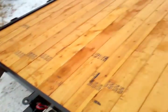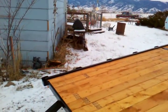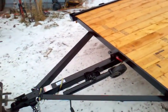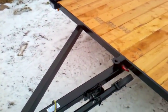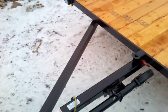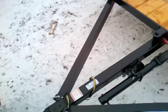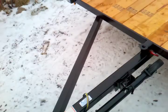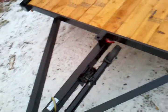Unlike a normal straight tongue snowmobile trailer, this is a tri-frame tongue with three hinge points underneath, and they're all grade 8 bolts. That tri-frame tongue keeps you from shearing off the tongue when you jackknife the trailer. It's 3/16 thick, not eighth inch like other ones. The tongue is tube steel but we go with extra thickness — with eighth inch it rusts all the way through, but with 3/16 you'd have 50% left.